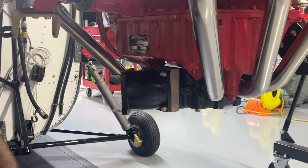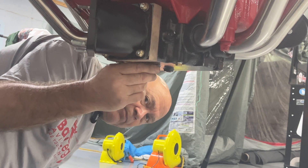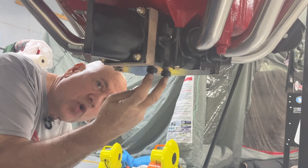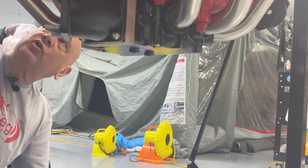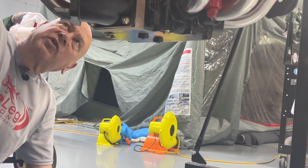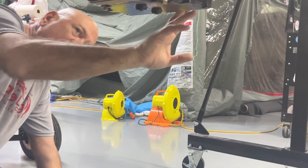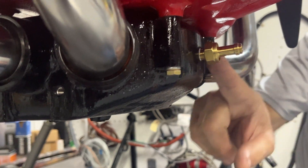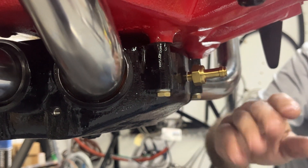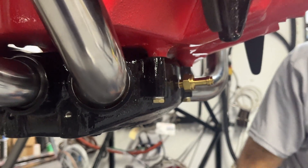If you look at the cold air induction system down here, on the bottom you can see these two boss fittings — you'd normally put a snorkel fitting in there. Basically, when you shut down an injected engine, you'll get some fuel leakage from the cylinders from the spider up on top; you want to drain that out of the intake system. So if you come around to the backside, since we're going to be back at that 35-to-40-degree angle, I drilled and tapped the sump here and we've got our snorkel fitting there. That'll be pretty much straight down and drain this sump really well when it's installed.